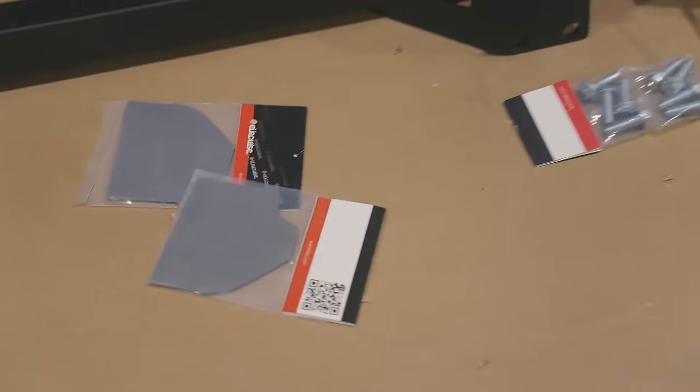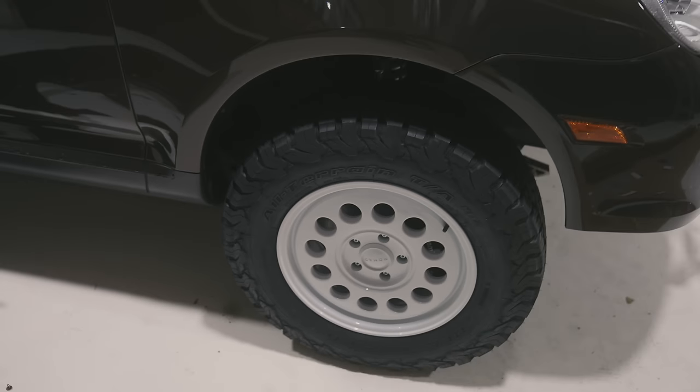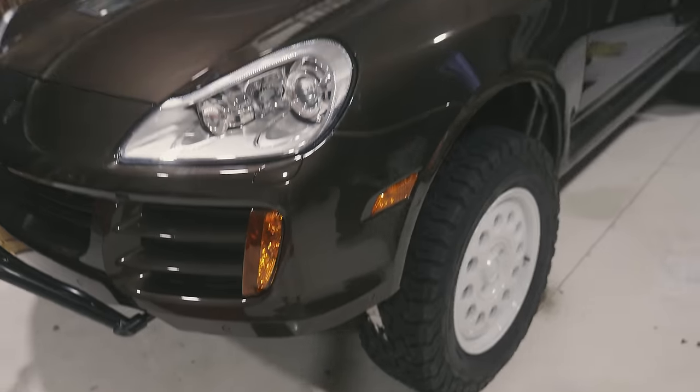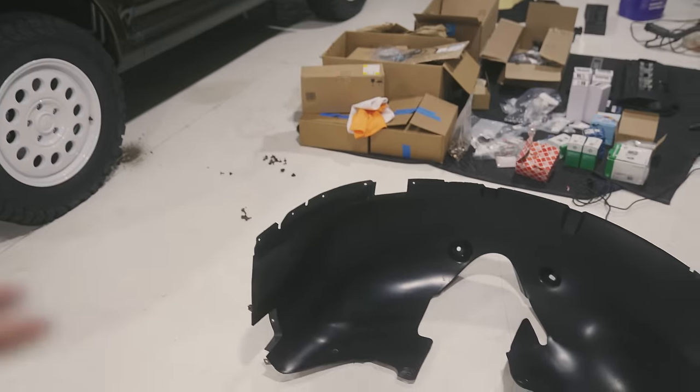And the reason the fender liner is out still is because there are these plates, these two right here, that are gonna get welded in to, I guess, the pinch seam or the rocker. You push it back about an inch, just so you have proper clearance for larger wheels. Right now, it slightly hits that when turning, those plates fix it up. Someone was supposed to come and weld those in before this video, but couldn't get them here in time, so I'm gonna leave the fender liner out, along with the hardware, of course.